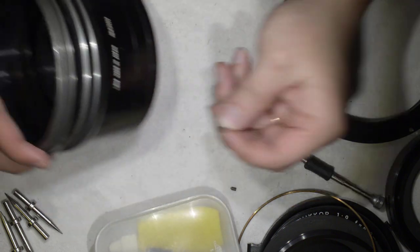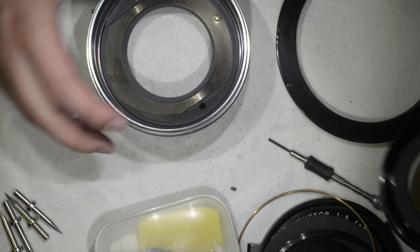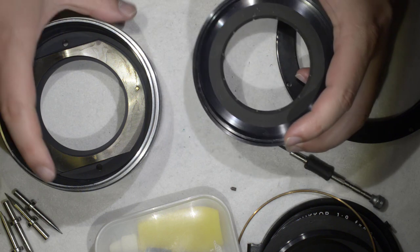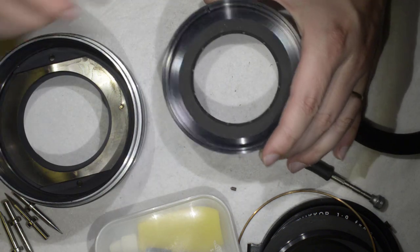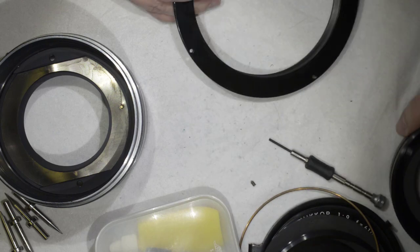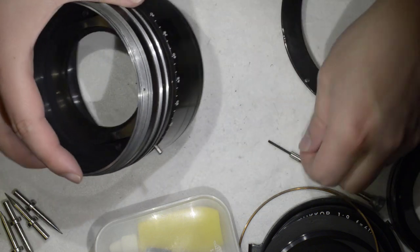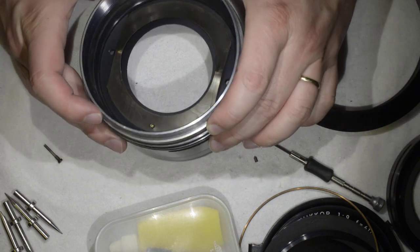and it's to connect this pin here to the rest of the mechanism, and then I was able to remove here. There's something I don't get here, but anyway I will check it just after. I was able to remove also the full aperture mechanism here that you have. I didn't disassemble it because it's mounted. I was able to do it because I removed this screw here on the back, which was hidden by the aperture ring. Okay, so we have this left to remove.